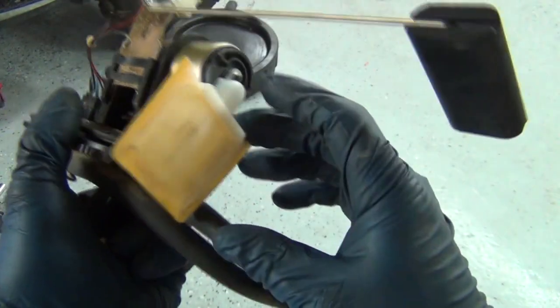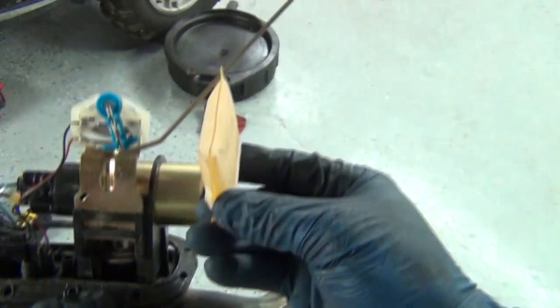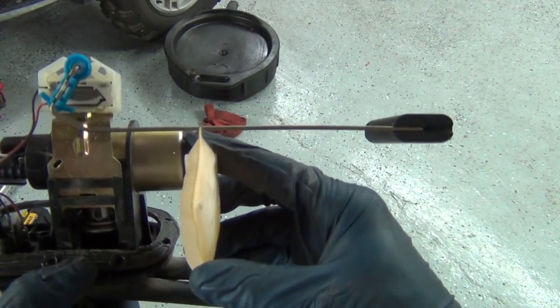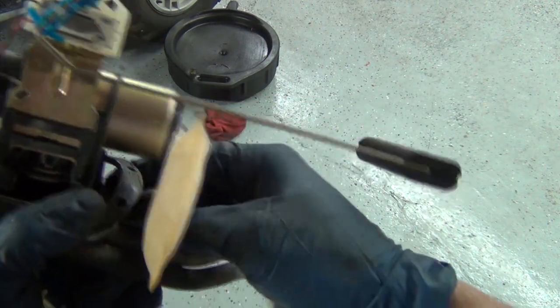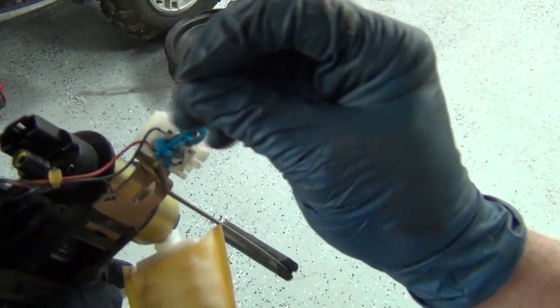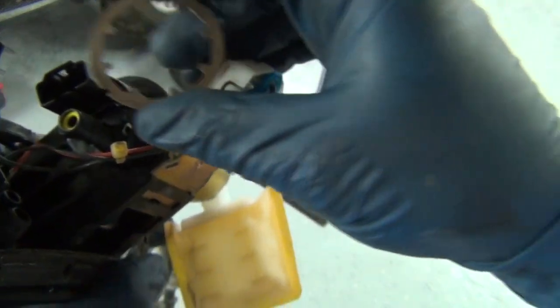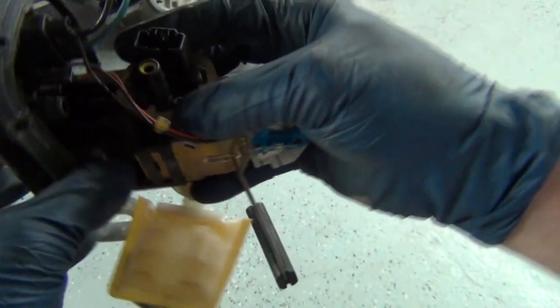The float position is not okay if it's showing low on gas. The best you can do is just shy of touching - leave maybe 3-4mm of air gap there. When you go to put this retaining ring on, make sure that the tips are facing up, not down - it won't go on very well. Then that little part that I showed you, you have to line that up with the little rib that's on the bottom there. So we have our orientation right there.